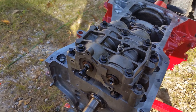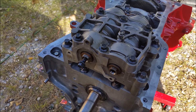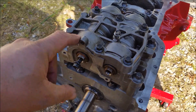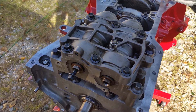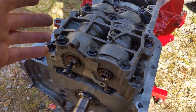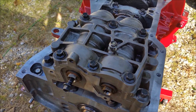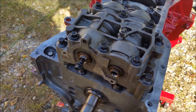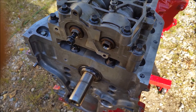The next part we're going to put on is the balance unit. Some people like to get rid of these, but there's a reason the manufacturer spent a lot of money making something like this and adding it to the motor with the timing chain gear. If it makes the motor run smoother, so be it. You torque it to 35 foot-pounds in a crisscross pattern, then rotate the bolts 90 degrees, and that's set. Then we're going to put the timing chain and the head on.